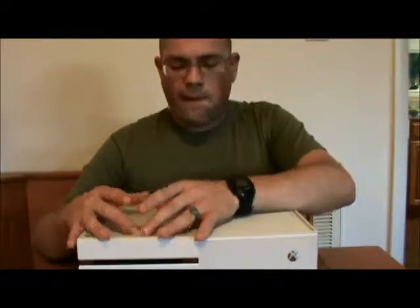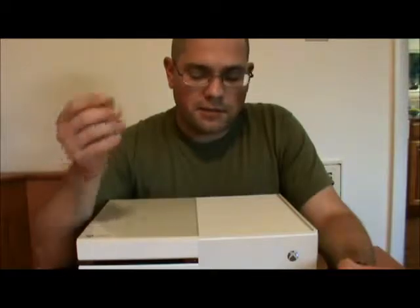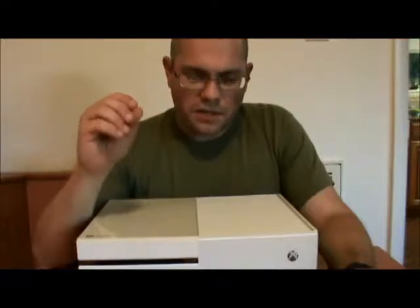But what's happening is it's only coming in a quarter inch short of where it should be, and it's not reading. Because the drive clamps shut on it, the motor spins, scratching up the disk. Thankfully not in any sectors that actually have real data on them. But still, it's a bit of an issue.